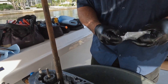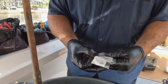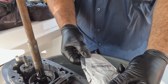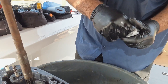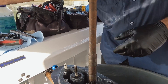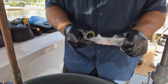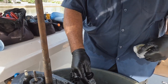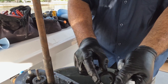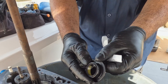These are the seals that were leaking. The seals don't come in the kits — you've got to buy them separately. Just because you're doing a water pump doesn't mean it includes anything else. Always take that extra step and verify everything else is good; one of those things where people say 'just replace the water pump,' but you really should check everything.